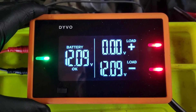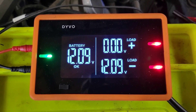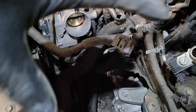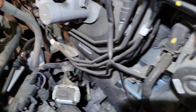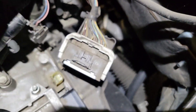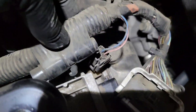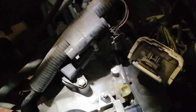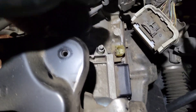Now we're going to check transmission fluid and move on. To replace the TCM you have to take out the air box — the upper air box, the air filter, and the lower box with the 10mm bolt. Take out the battery tray which has three 10mm bolts in the bottom, and take out the battery. Then you'll get down here to the transmission control module connector, a sensor connector right next to it, a plastic post on this bolt, and I think three bolts holding it in. We've got to take this out and send it to be rebuilt.